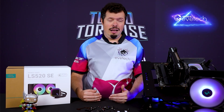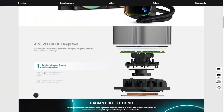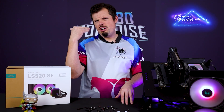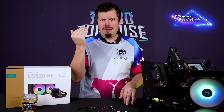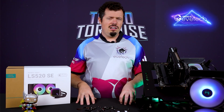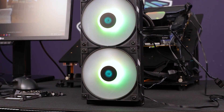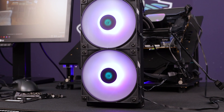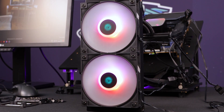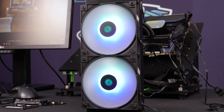The Corsair H100 is no slouch — it's our test bench radiator for a reason — but DeepCool's LS series and upwards continues to prove better. These have incredible fourth-generation pumps, basically the same from the LS to the Castle. The difference is some tuning: the Castle does have a slightly higher pump RPM. This one topped out at about 3,100–3,200 RPM, exactly in line with its specification. The quality and air pressure from the fans would give a better audio profile on the higher-end models; this one is more rudimentary in fan execution but the performance speaks for itself.